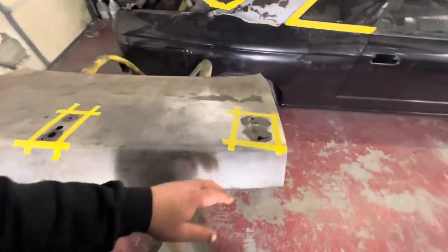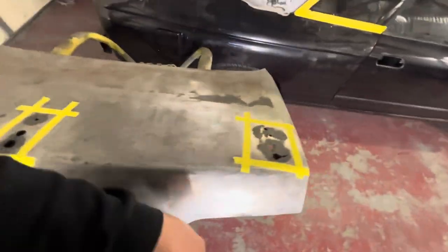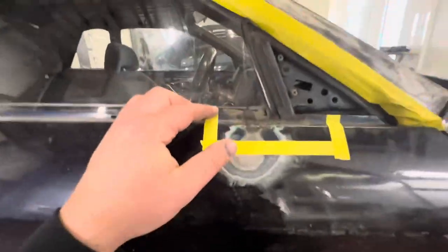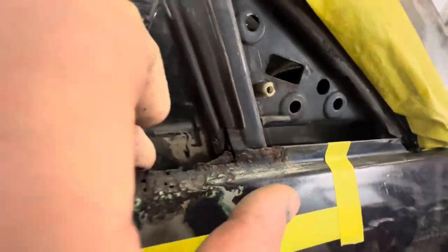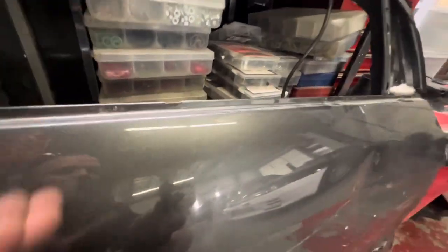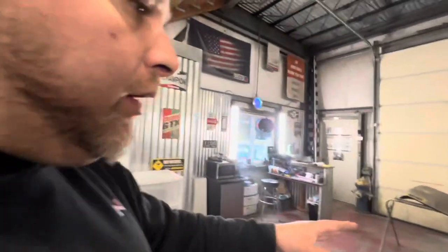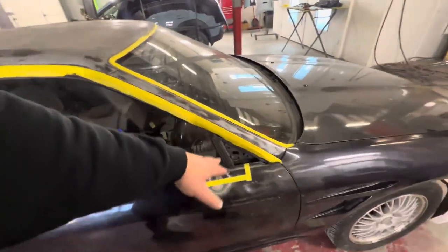We will have to refit the GTR spoiler — before it gets prepped and painted, we want to test fit and re-drill our holes because the holes are going to be gone once we weld this up. We also have a small section on the driver door that is rotted out and actually separated from the inner structure of the door frame. We've already got that marked out. We're going to cut out a nice little section and use Carmen's daughter Brittany's old Ford Focus door from our scrap pile — it has pretty much the exact same curvature. We'll take that piece, lay it on top, mark it out, cut a section off the Ford Focus door, fit it over, clamp it in place, and weld it in — completely grafted in. It'll be kind of like a Ford slash Nissan mix.